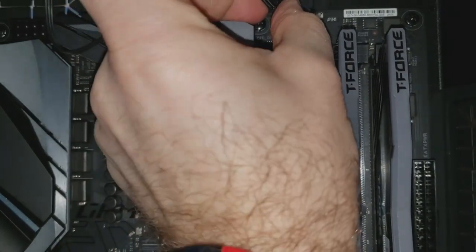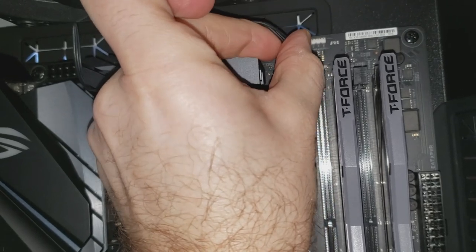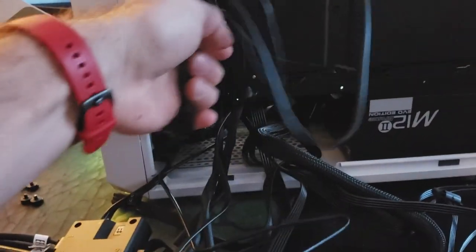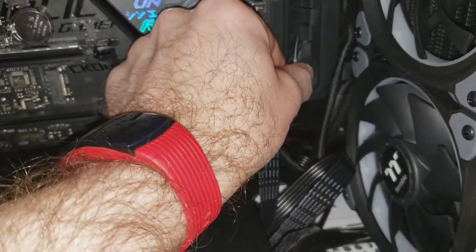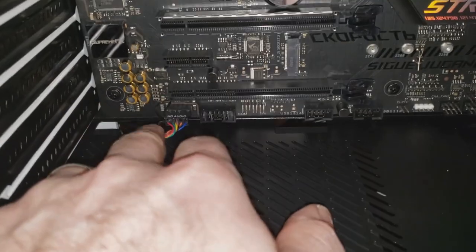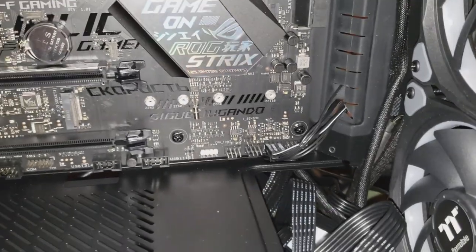It's kind of tight in here — that's why I wanted to get this done before the large graphics card is in the way. I now have a whole mess of cables in the back but all the ones from the front are running through the rubber ports. I'm running the main 24-pin power cord for the motherboard through the top section of the case routing to where it gets plugged in. Actually, I don't like the way that twists, so instead of using the top port I'll run it through the bottom one and curl it up to the connector.